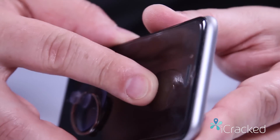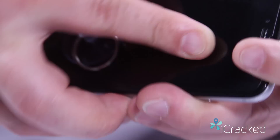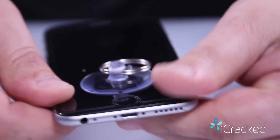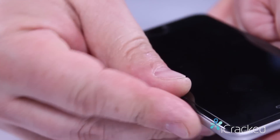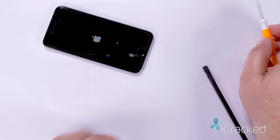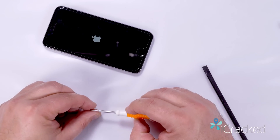I'm going to take the screen, set it back in by sliding it up to the top of the frame, close it, come down to the bottom, and work my way up the sides. Remove the suction cup and go ahead and power it on — it should boot right up. While it's booting, I'm going to go ahead and reinsert the pentalobe screws.